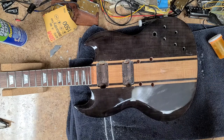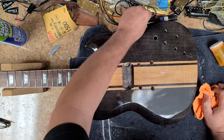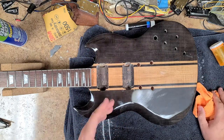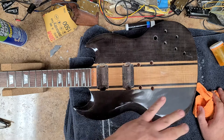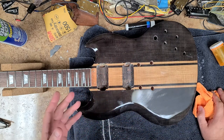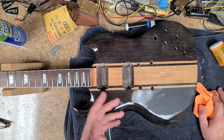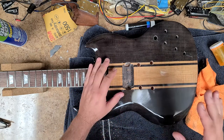This is something that we've done years ago. Always have done it on any vehicle that we worked on. In order to have that nice gloss finish that looks like glass all the way down without the waves, without any of the craters, fish eyes, whatever you want to call it, block sanding is the way to go.